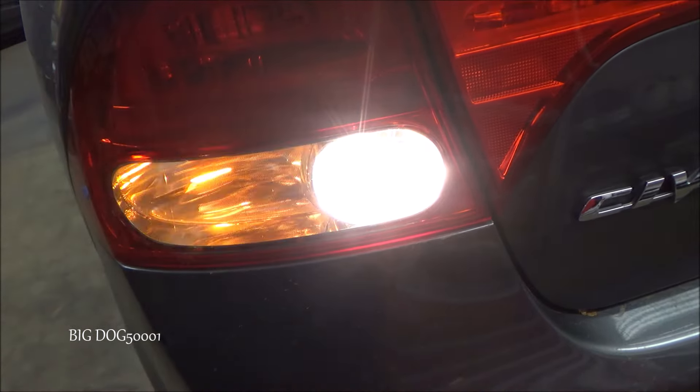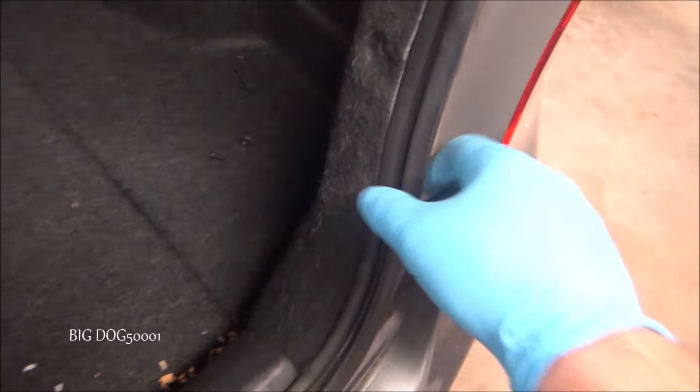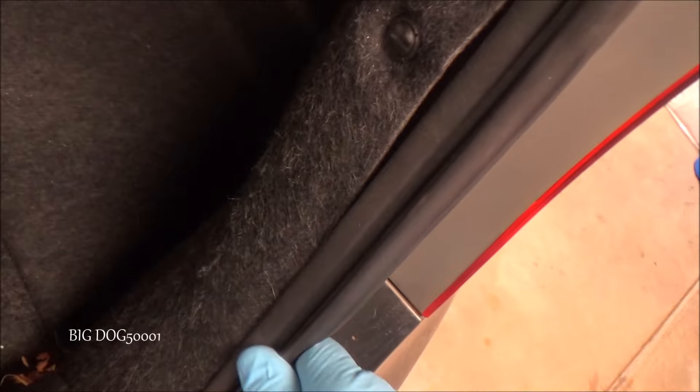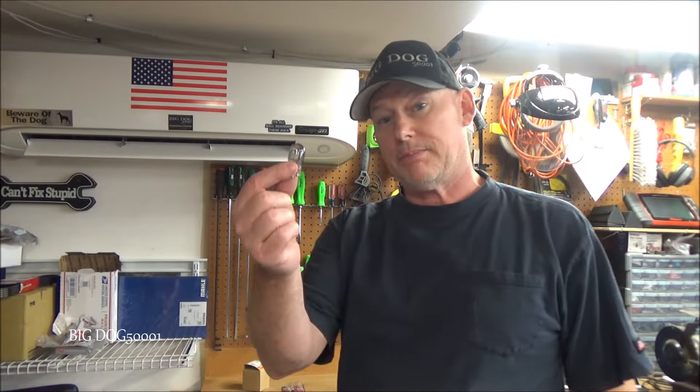Let's make sure the rest of the lights work. Looks like our reverse light and turn signal on that side are working, and both working over here too. I think all the lights are good to go on the rear now. To button it back up, I pull this weather strip back a little bit so we can get this lined up easy — you can see the holes are lined up perfect. Pop the clips in, then grab the center pieces — these are designed just to push in. Get the weather stripping back in place and make sure the carpet rides in the channel properly. Three bad bulbs and a bad socket, but not too bad of a job. If the video helped you out, make sure to give it a thumbs up. Thanks for watching.